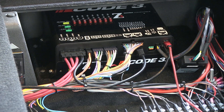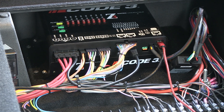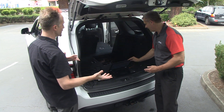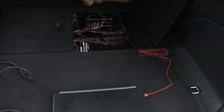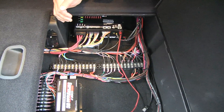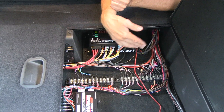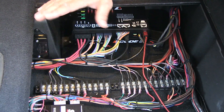So looking in the Durango that you have here for your demonstration vehicle, tucked away inside the storage compartment in the center, that is the amplifier — the brains for the system. That's where the magic happens. The great thing about the configuration of the Z3 Matrix is it's very installer friendly in that everything is done on one side. They don't have to leave it exposed in different areas. Your power wires, output wires, input wires, computer hookup, OBD2 connectivity, and speaker outputs are all on one side. It's very nice as far as that goes.